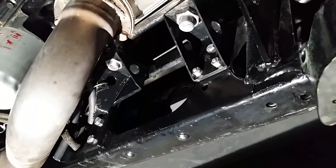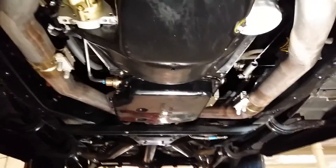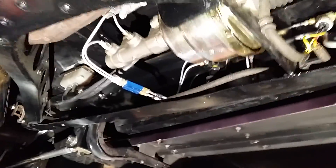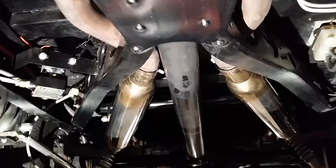The steering goes back up and enters through the firewall into the driver's compartment, so I'll be interested to see how the car steers and handles. It doesn't look like there's any kinking or weird angles those knuckles have to achieve. It's an all-steel car — steel running boards, steel body. We did some magnetic adhesion on it earlier and I'll show those results when we get outside. Power brake booster reservoir is accessible through the rear floor. Stainless Cherry Bomb-style exhaust with stainless band clamps.